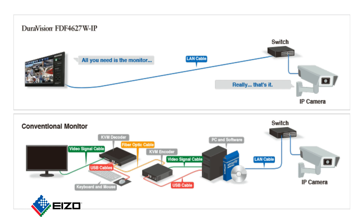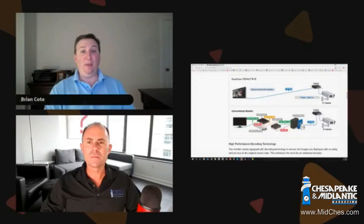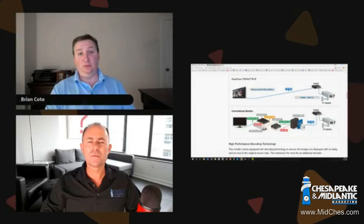So if we think about a nursing station — nurses have a lot to do, and they have very little space to do it all in. With our monitor, the unique thing is you hang this thing on the wall, you plug in a power cable, an RJ45 network connection, you can mount it very cleanly on the wall, then you just go back to your setup workstation, you can remotely set it up the same as you would remotely set up a camera, and now the monitor is displaying live video. No need for other boxes.